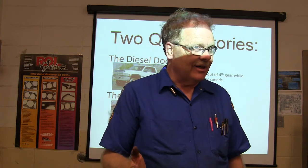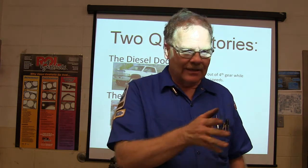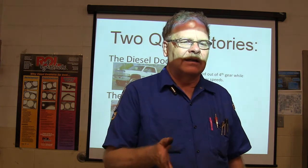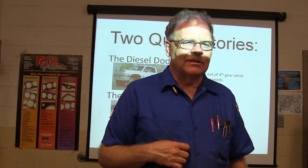And so we were swamped back there in the service department, so they shot it over to a transmission shop. And that's a diesel Dodge. You remember it's a diesel, but it's got an electronic transmission. He said, put a throttle position sensor on it, see what that does. If that doesn't fix it, we'll have to tear the transmission apart.